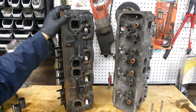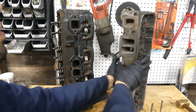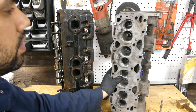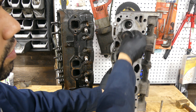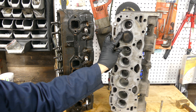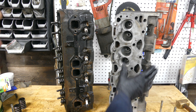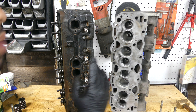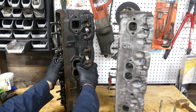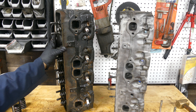Eventually we're going to be doing a build-up with this head. Even though the valve guides are all worn, this head was a rebuilt head - it's the same head we saw in the previous video that I put in the blast cabinet. Whenever your valve can move like that in the guide, that's never a good sign and shows you probably don't have the best core to build off of. But we're going to turn lemons into lemonade with these cylinder heads. If we're comparing aftermarket castings to a factory casting, this casting is far superior - you can see the port size difference and some of the undercover porting.